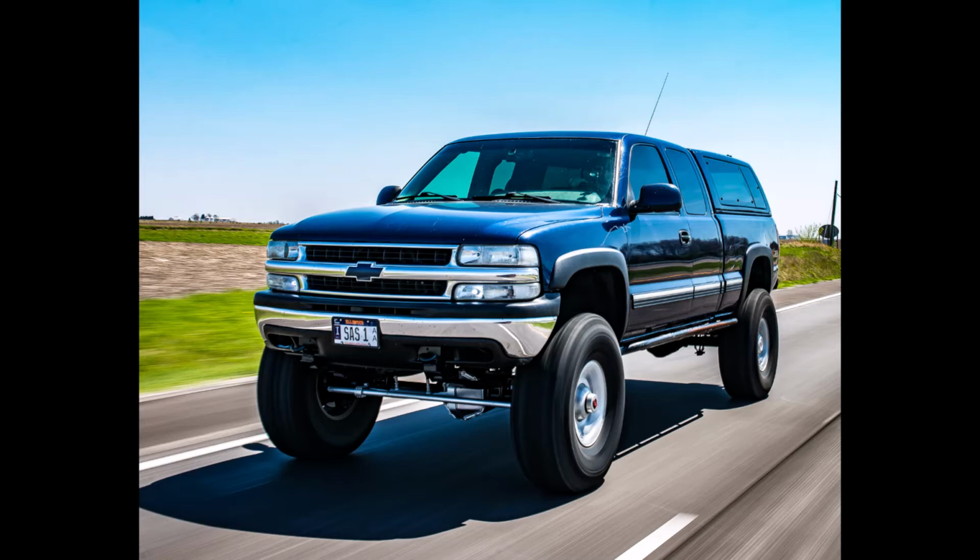Those AccuTune? Like an accumulator. Accumulator, that's what I call it. Oh, who was this selling those? Was it Summit? Summit sells one. I think it's AccuSump or AccuTune. It has two or three quarts of oil in it, and it has a spring. It's air loaded. And then once the oil pressure drops, it opens the valve.